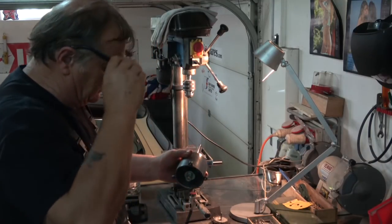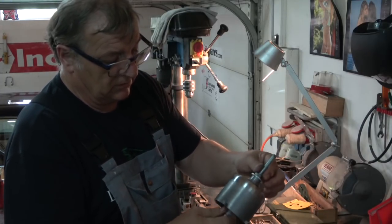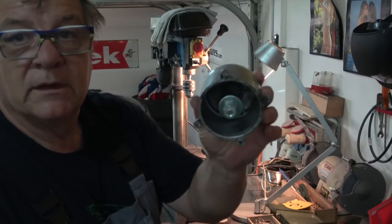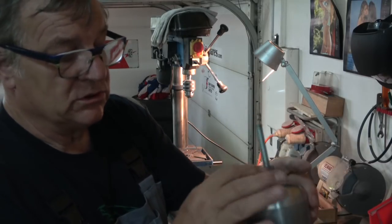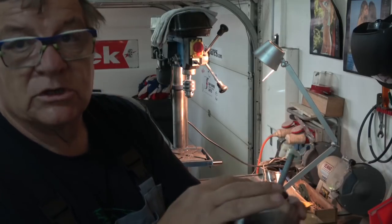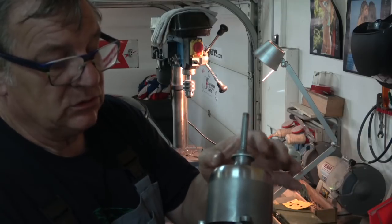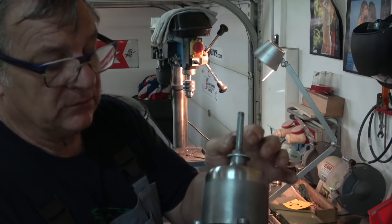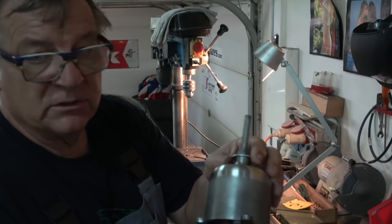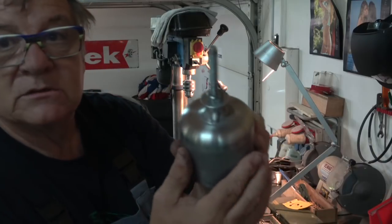This was a shaft. It's just a threaded rod that I had, and I put a locking nut on it so it didn't come out, and I put big washers on the bottom. And the best way to do this is to find a shaft that's almost tolerance fit on the inside, but you don't want it too much of a fit, because if it slips, it's going to damage the inside bit. I wanted to just show you that bit there.